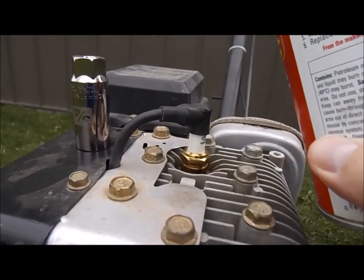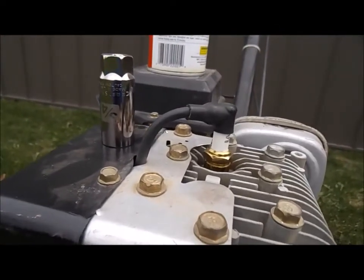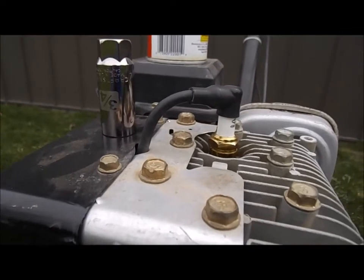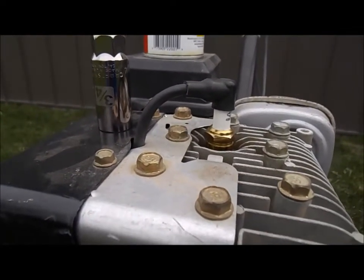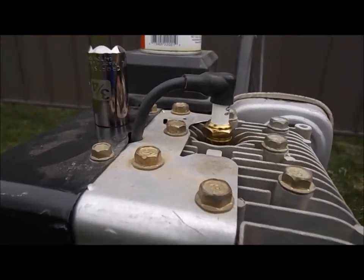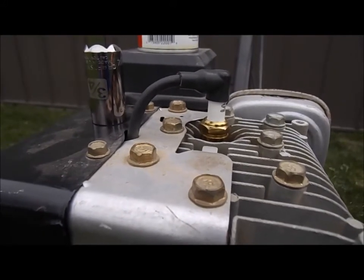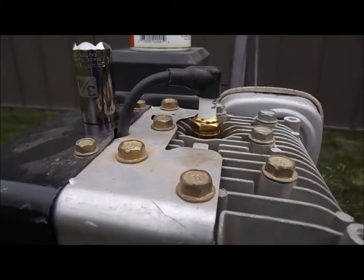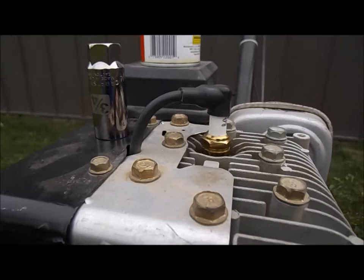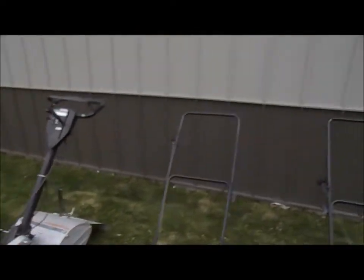If there was no fuel and the spark plug wasn't wet — like this morning, I pulled this thing quite a bit and the plug was dry — spray some fogging oil down there. That stuff will burn and it'll really puff because it's burning oil, so it's going to be pretty smoky. But what it's doing is as the engine spins it creates vacuum and starts to pull fuel. It ran a little on the fogging oil, died, I pulled it a second time, and then it was running on gas.